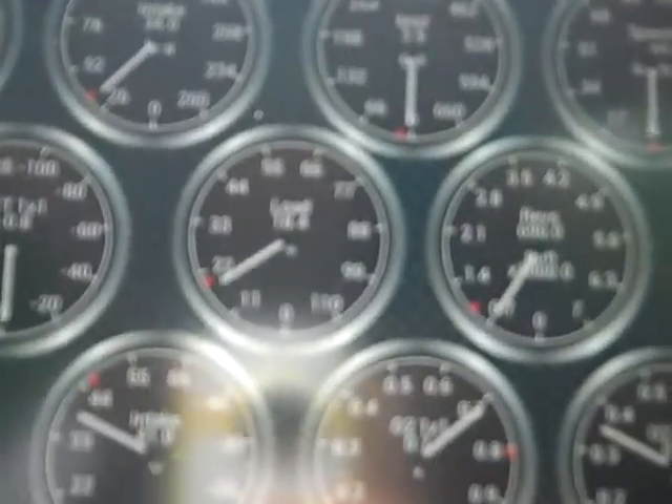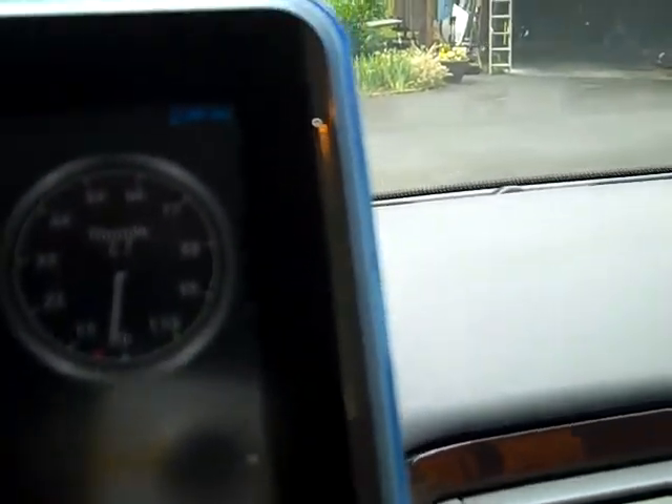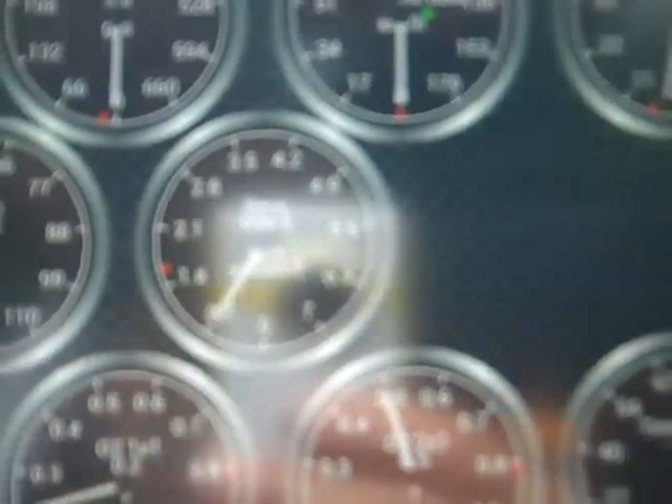I've just started it so coolant is 74. Intake is coming in at 34 kPa. The MAF is running at 3.9 grams per second. There's no speed because I'm not moving. Throttle's at 2.7% - that's just idle. Fuel trim bank 1 is 0.8 and fuel trim bank 2 is 1.6. Intake temperature is 40. 17.6% load. The revs are 694. It tells me everything.